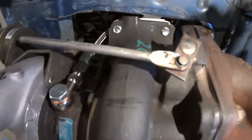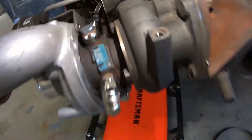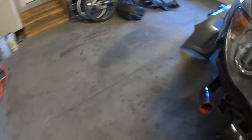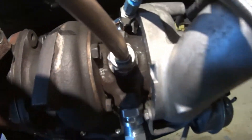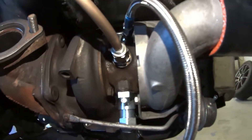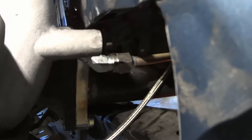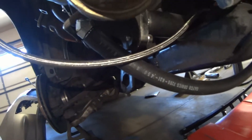Right down there is a hard line for the coolant feed, and since it's so close to the manifold we were able to make hard lines for that. Going over to the other side — similar setup here on top — you can see the banjo bolt for the oil feed, and the coolant return is a hard line going up right through there. There is the oil drain, and on the other side we also have a 45-degree elbow coming off that side. There is the other hard line going next to the exhaust manifold, and there is the oil drain line going down to the scavenge pump.